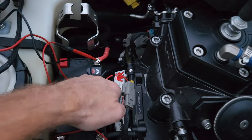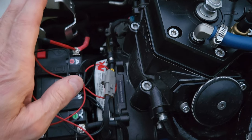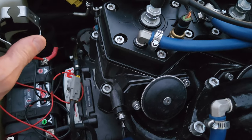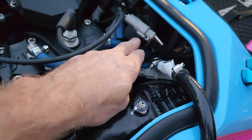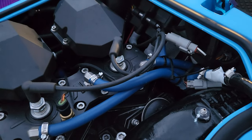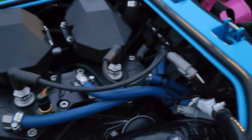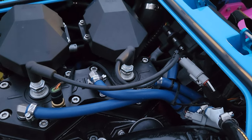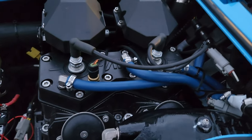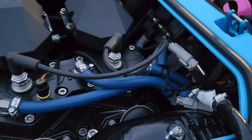Basically, you've got a stator and a flywheel down here which is kind of like an alternator in a car, but nowhere near as powerful, so just minor amounts of power get put out. It goes to a voltage regulator which is usually buried in the back somewhere, and that prevents it from overcharging or overpowering any of the electronic circuits and burning them up. Most voltage regulators will run somewhere between 12.6 and about 14.4 volts, and anything over that could start to get dangerous — you'd need to replace your voltage regulator if that happens.